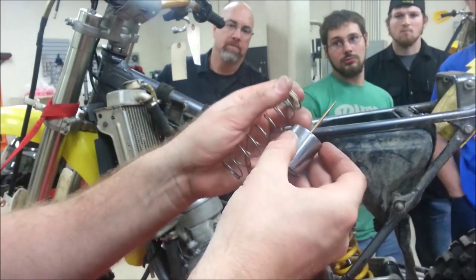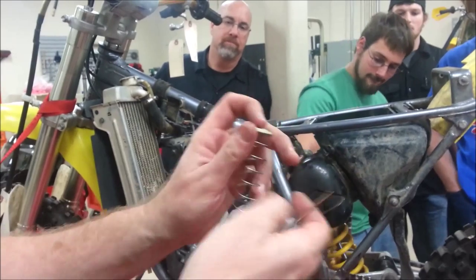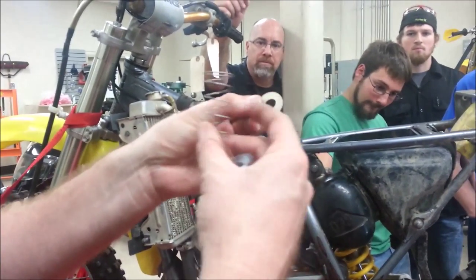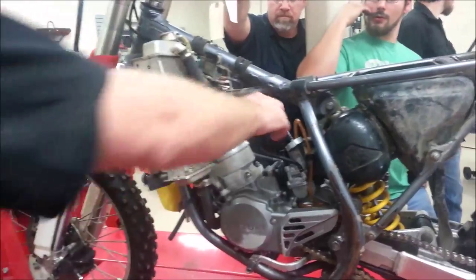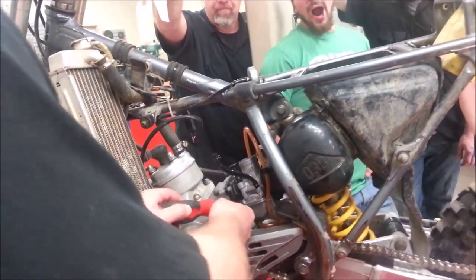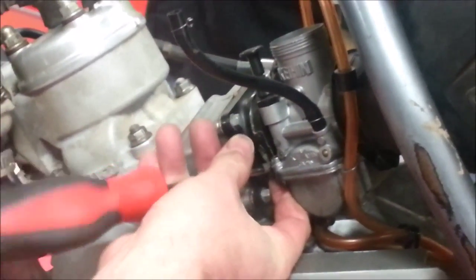You don't want to shoot that across the room. Would putting this in a baggie be good? You need to be really thoughtful about how you store it — if I put stuff on top of this I'm doing the same damage. I also notice this spacer has that little ring in the middle — it's the same on either side, and that centers the spring to cradle around that plastic spacer. We'll get more into that in fuel systems. But that's out of the way — back to the actual carburetor removal. These clamps are often way over-tightened.